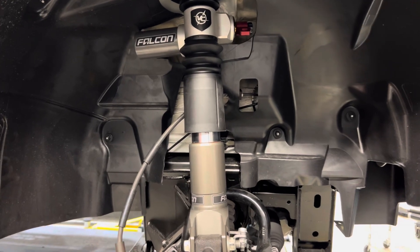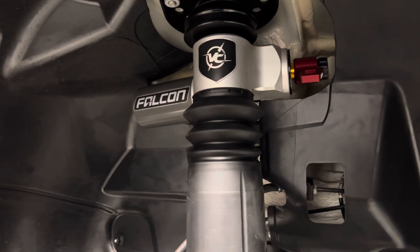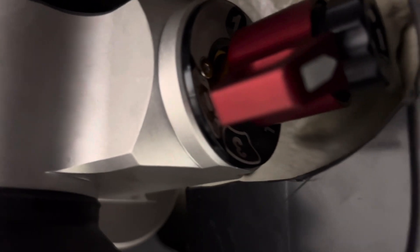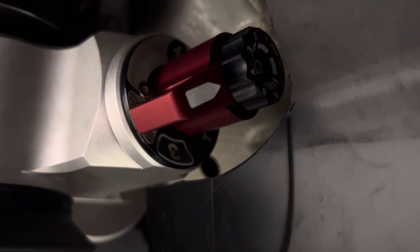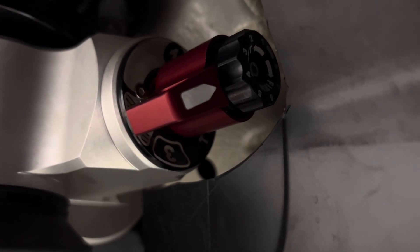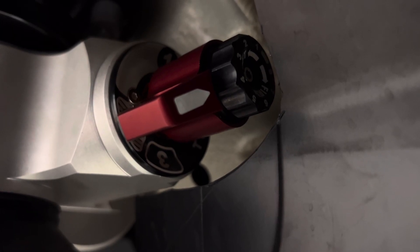Similar to the auxiliary Falcons, these are a 10-way, so you've got the adjuster up here. One is full soft, three is full firm, two is in the middle — the custom setting. On two, there are eight adjustments from soft to firm, so 2-1 would be one step firmer than one, and 2-8 would be one step softer than three.